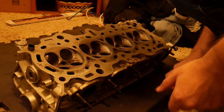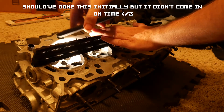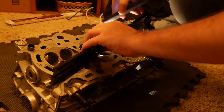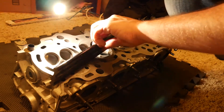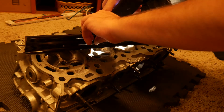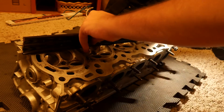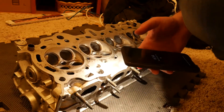After I've got the valve seals in, I'm going to make sure everything is perfectly flat with a straight edge I bought on Amazon. I didn't have any feeler gauges to check it out, so I'm using light — making sure I'm hitting every single angle. If you see any light, there's clearance between those cylinders and you need to get it resurfaced. Luckily for me all my hard work before this was not wasted, so let's continue on.